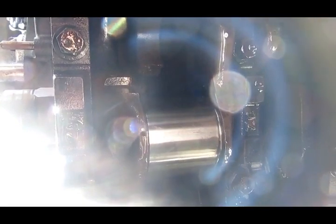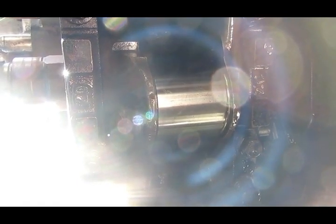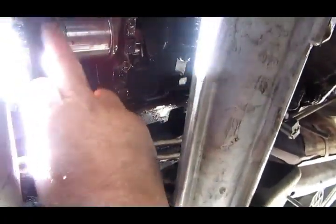I just did a couple filings with the files, then hit it with some 400 grit. Look how beautiful that is - that's with 400 grit and just the shoelace. It's not a whole lot of work, just go over it back and forth and it just cleans it up. Just got to make sure you feel everything with your fingers and make sure you don't have any high spots on the crank. As long as everything feels good, I'll hit it again with 600 grit and then we can start putting it together.